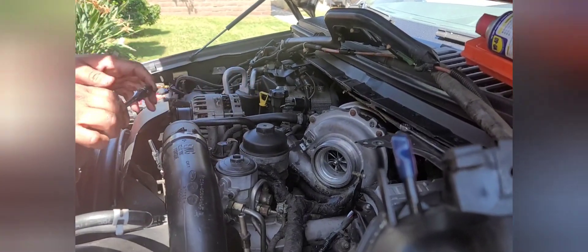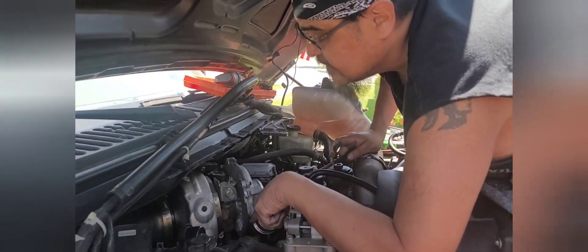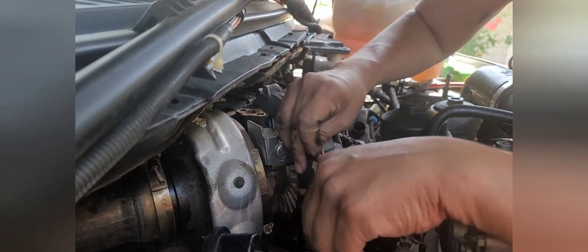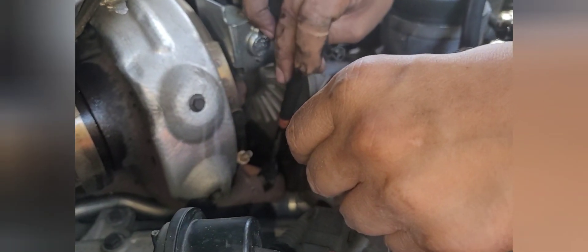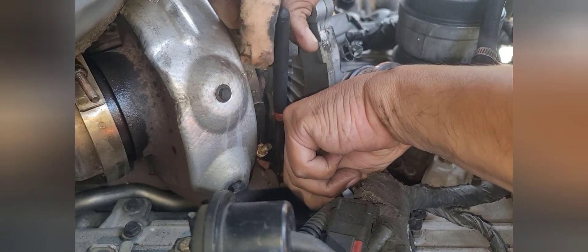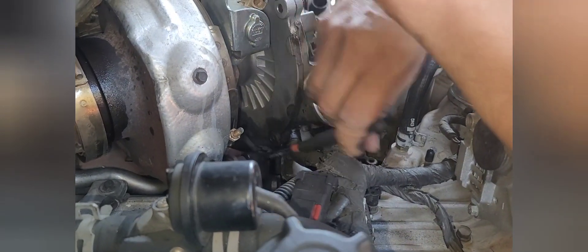There are three fasteners — besides the clamps — that mount the turbo to the turbo pedestal. They're 10mm fasteners. I'm going to use a ratcheting flex-head 10mm. There are multiple ways to get this one off but it helps to have a ratcheting tool. Get on there, crack it loose — you'll hear a crack. Once it's loose, just like the other ones, if you can see it you can pretty much get it by hand after that.